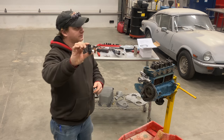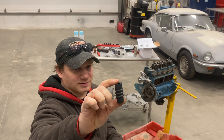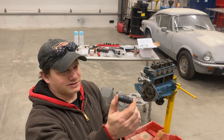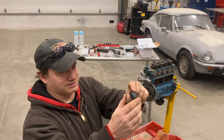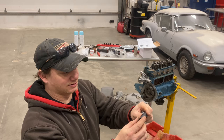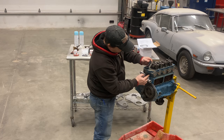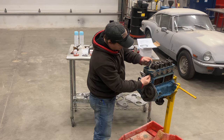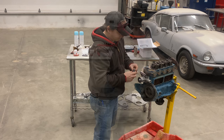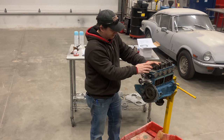Here's the special little hose — that's a special little hose that goes between the water pump and the head. It's got kind of a spring-loaded section in the middle of it. If you're trying to squeeze a regular length hose in there instead of using this, it's going to be pretty difficult unless you take the head off and do it the way that I'm doing it here. It's just a whole lot easier to put it on doing it this way. Another thing to look for: usually this fitting coming out of the bottom of the head rusts away, so you want to make sure that that's in good shape before you go putting it back on. I'll tighten this up once I get the head mounted in place.